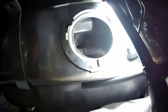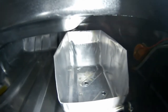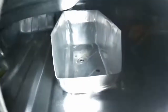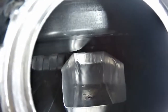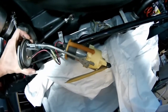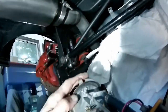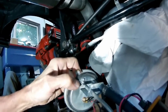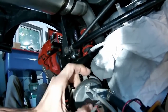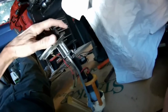If you've never looked inside a gas tank, this is what they look like. You can see there's a baffle tray where the fuel pickup goes in, and then to the right of that is where the level sensor is. So essentially your pickup is going to sit in there like this. I had a problem with mine in that it broke loose right here so I had to weld it back in. I think I've got my angle off a little bit — I've got to tweak the pump up a little because it's not letting me get the top of the flange matched up to the top of the tank.